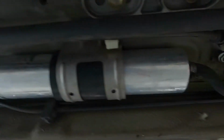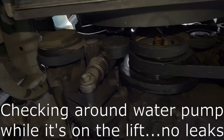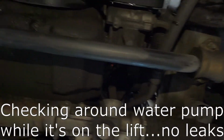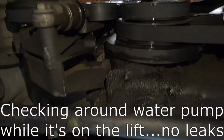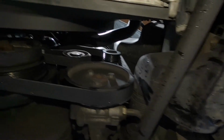And I would always warm it up first. And they've got three different fuel and ignition maps you can use. There's the stock one, and then there's one that switches itself into which map to use. So they could have put a little toggle switch on there if they'd wanted, right? But instead they put this little plug with wires. But anyway, I had never run the aggressive map, the one that advances the timing and leans the mixture. I'd always warmed it up. I'd never raced it. And so there's basically no excuse for it to just disintegrate, for it to take out the rod bearing.